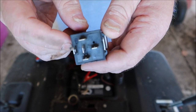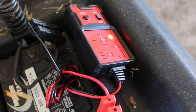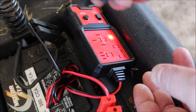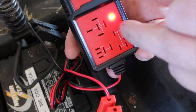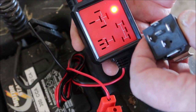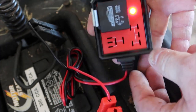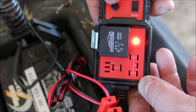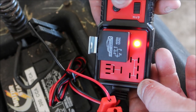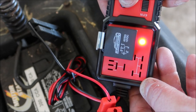Let's go ahead and get this one plugged in. As we can tell it's the five-pin, and we're going to find the five-pin receptacle on the tester, go ahead and plug it in. It's going to cycle this relay several times, and if the red light turns green it's good; if it stays red, it's bad.